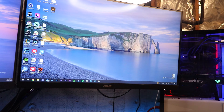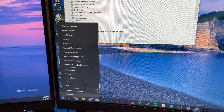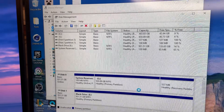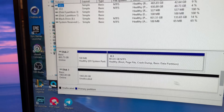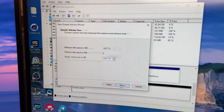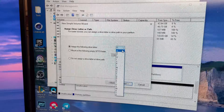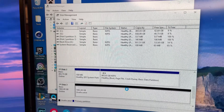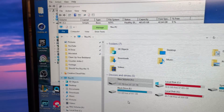Once you're on your desktop, you need to partition your new drive. Go to the Windows icon at the bottom left, right click, and select Disk Management. When you're in Disk Management you'll be prompted — click OK and you'll notice any current devices that you already have. At the bottom column, scroll down until you see Unallocated Disk, which looks almost grayed out. Right click on the box and click New Simple Volume. Press Next and then Next again. After, you'll see the option to assign your drive a letter — I did A for mine. Lastly, it asks you to name your drive, which I left default by clicking Next again. Finally, press Finish to complete setting up the new partition for your new drive. Now you can go into your file explorer and use your new SSD alongside your old one.